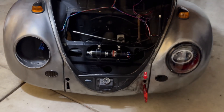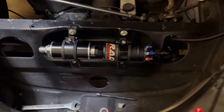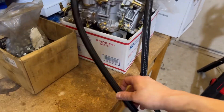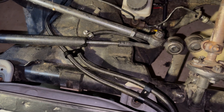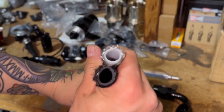Welcome back. We're making good progress installing the new RAD Performance fuel system, but I wanted to show you guys how to assemble PTFE lines. They're a lot different from your typical braided rubber line and use different fittings. The PTFE, or Teflon liner, is more resistant to ethanols, methanols, leaded gas, unleaded gas, oils, and transmission fluids.